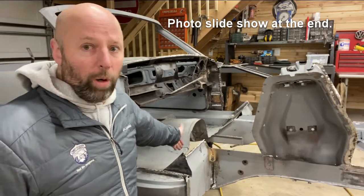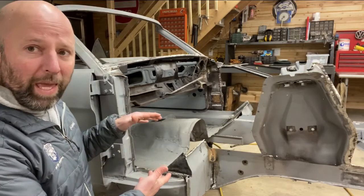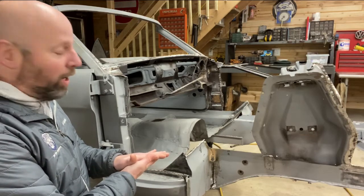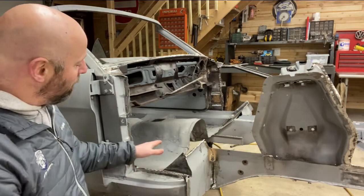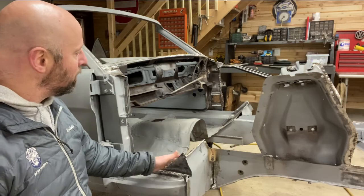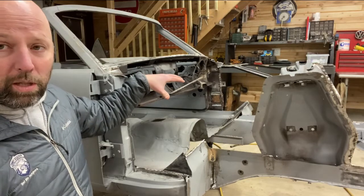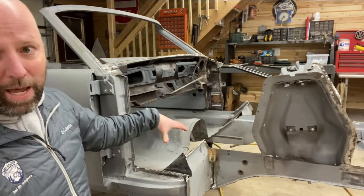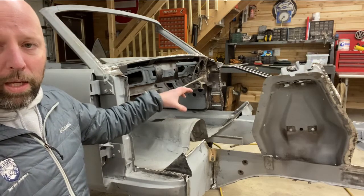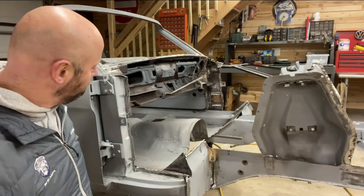I ended up cutting the floor panel, as you can see, the floor pan. Typically the floor pan would sit on top of the firewall. Now, my firewall is not going to be able to slip underneath because the floor pan is already attached to the frame members and to the torque box. What I've seen in other people's videos is that I will have to cut, tweak, and bend it to fit and slide it down on top of the transmission hump, possibly cut some relief cuts in it, get it to fit well, and then weld it in.